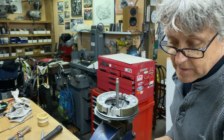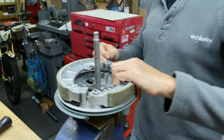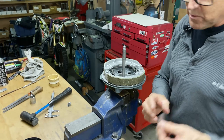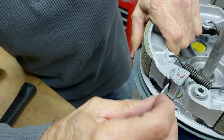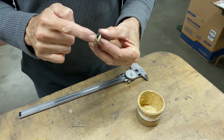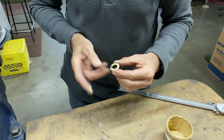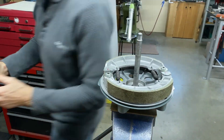Now we put in these spacers — this adds up to about 32 thou. I was just watching a video on YouTube recently, it was the Norton factory going back into the fifties, and they were showing how race bikes were prepared. They talked about the spacer and it was 30 thou — so that was like a confirmation. See how I spread it apart and put it in. Even though this hub is 52 years old, I think it has very little use, which is nice. Often when you get this old stuff you can have some problems, especially if it's been abused. So there's that and two cotter pins.